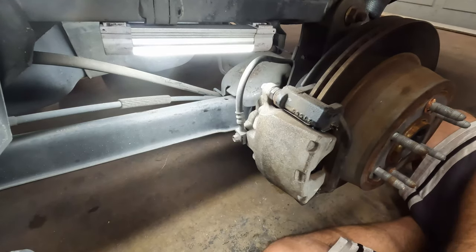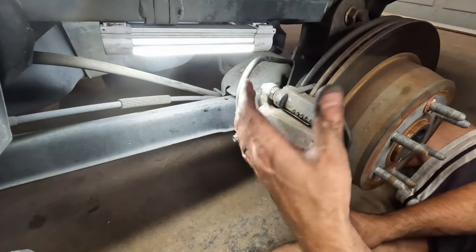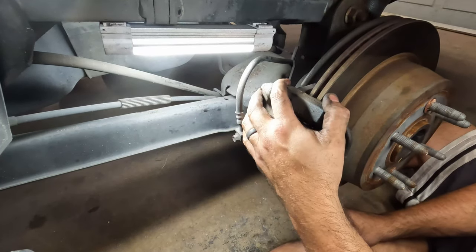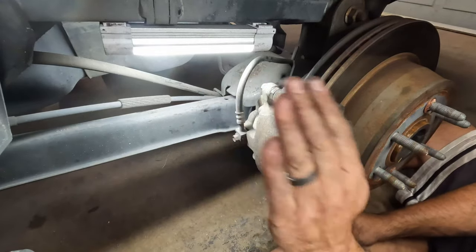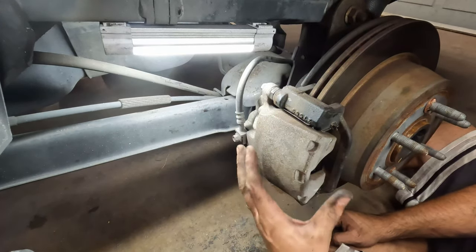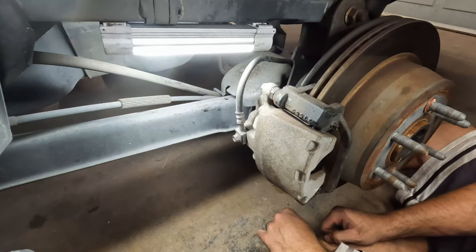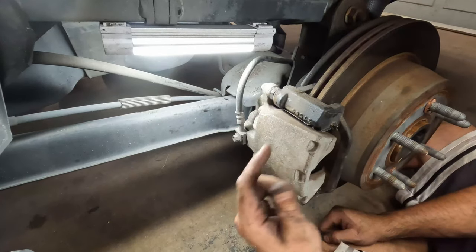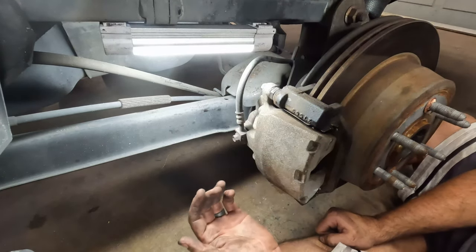These don't have to be super tight — just get them snugged. They're not really holding anything of any great pressure. Snugged up and then just one push — one 'ooga booga' as a friend of mine says. Then we're just going to do the same thing on the other side. This probably took 15 minutes. Once you're done, drop it back on the ground, go for a little drive, pump the brakes — it'll self-adjust and reset back to a good snug brake. Start the car, pump the brakes a couple of times, back up the driveway, and you're good to go.